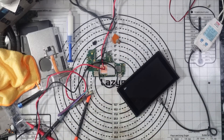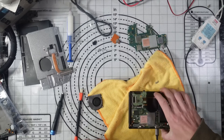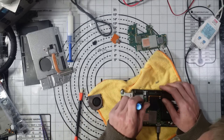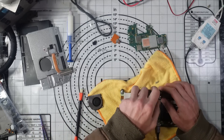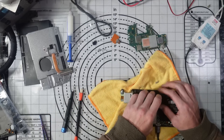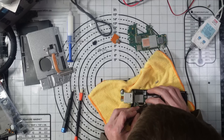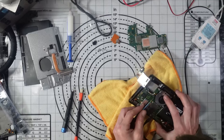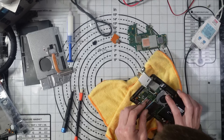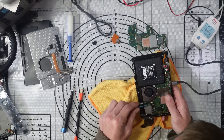It is indeed charging. I'm going to leave that charging for a few minutes - hopefully it doesn't take long but it is pretty dead. We have a backlight and it is pairing up, so no 2101 error code. Obviously I didn't see the 2101 error code verified, but the fact that it was stuck on 5 volts - that's all I need to see to know we've got an issue most likely with M92. You don't need to verify a 2101 error code if it's not charging.